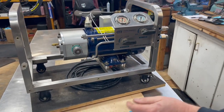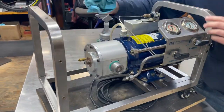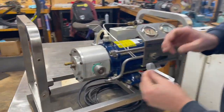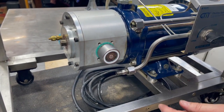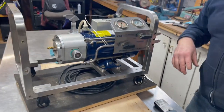Wipe off a little bit here and now we'll install our PTFE seal — very important, don't forget this. Sometimes they fit snug, sometimes you have to tap them a little bit with your mallet to put them in there.